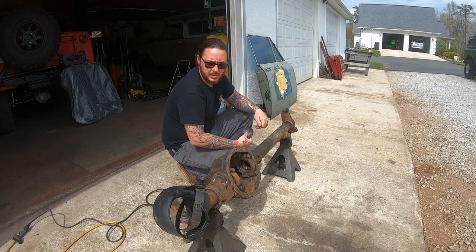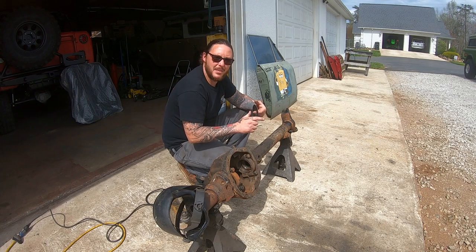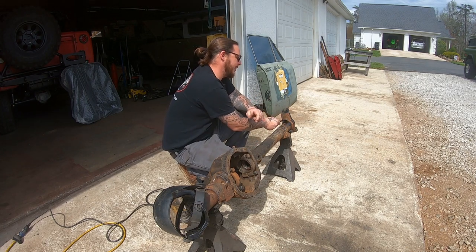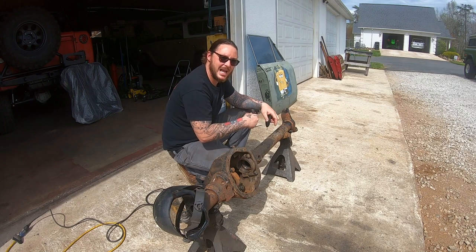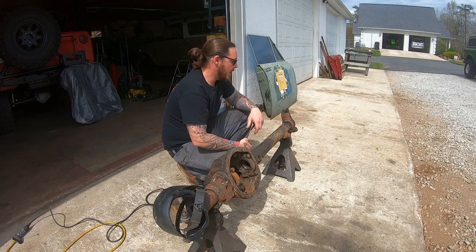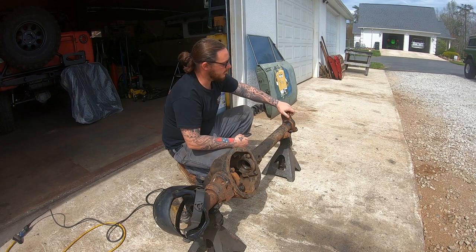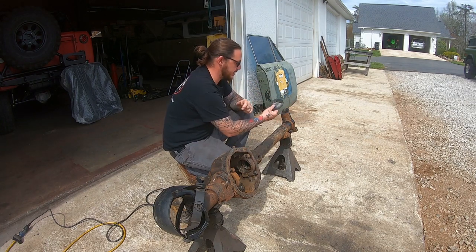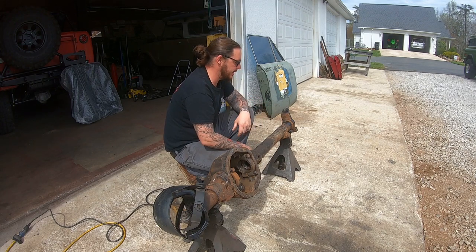I know that sounds archaic, maybe caveman-ish, if you will, but cutting that weld out, if you get a good sight line on the hairline crack, a little bit of preheat to oversize this. I say preheat with caution. Don't lay a torch on this till it's cherry red. Metal fatigue is a thing.